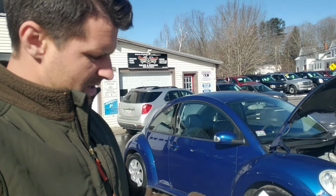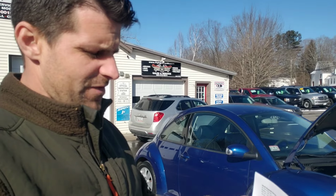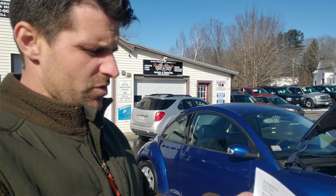What he told me was specifically, I'll read it to you. Diagnose Volkswagen, diagnose no start. Found that instrument cluster is faulty and not receiving data from the network. Advise shop to replace the instrument cluster and call for programming.